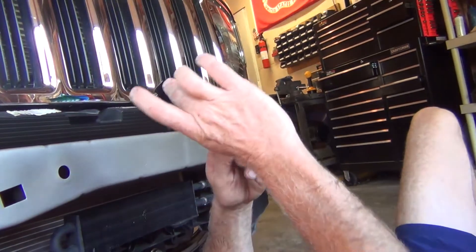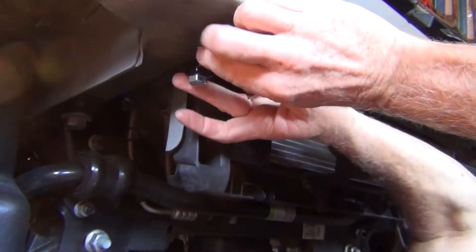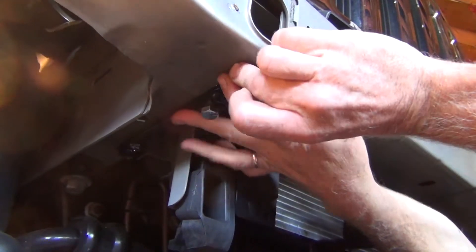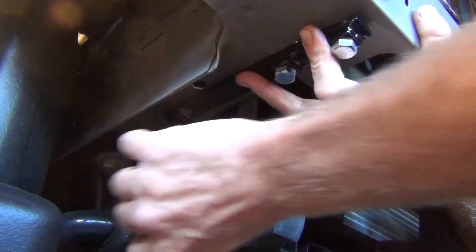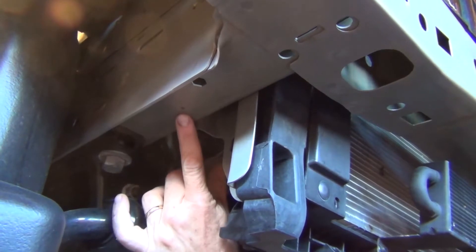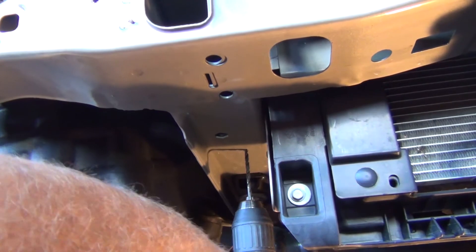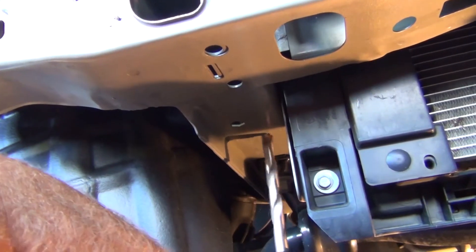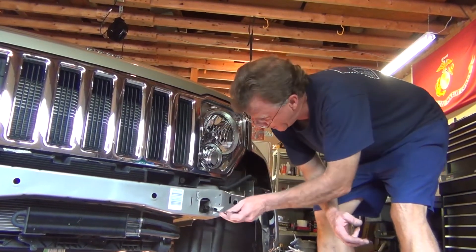The next step: we had to take two of the bolts that came with the kit and one of the strips, and put the bolts through backwards. Underneath here, you can see these two holes where you're going to stick this in. Then you're going to mark where the other hole is going to be, because you're going to have to drill that. There's my mark right there — that's where I'm going to drill my hole. I'm doing my center punch first, and a half-inch hole, but that's a little big for the first drill, so I'm going to do a pilot hole first. Two holes have been drilled now, one on each side. Now you just insert the strips in.